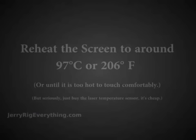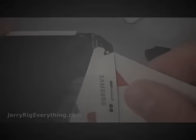Because the screen is so thin, the window of opportunity that you have to pull off the glass is relatively small because the screen cools down so quickly. And when the screen cools down, the glue is not as liquid between the glass and the LCD, and is much harder to separate.